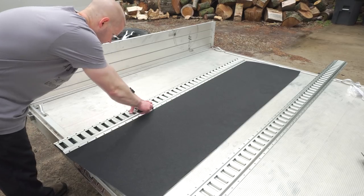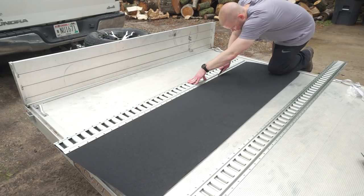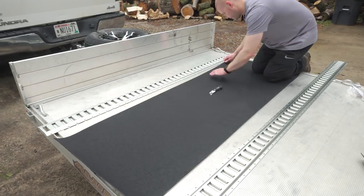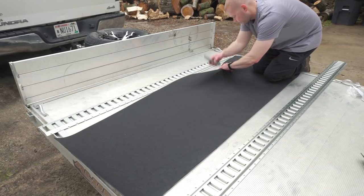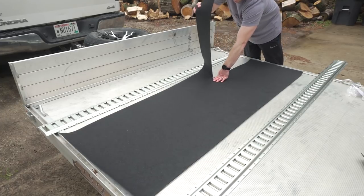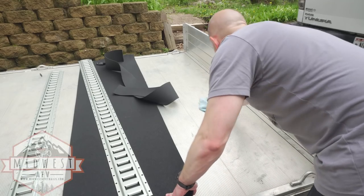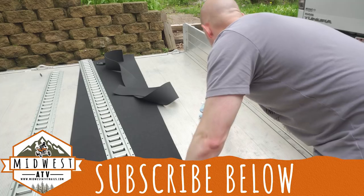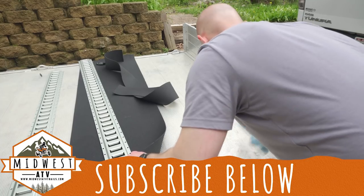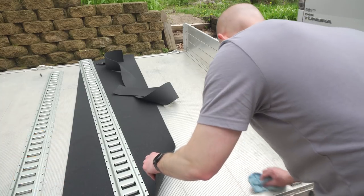The reason I'm cutting this rubber is because different types of metals often do not go well with each other, so I'm putting a rubber barrier between the aluminum and the galvanized e-tracks. One lesson I learned: if you score it deep enough you can really just peel it back. I already cleaned the surface off but I'm getting a little more gunk off so I have a nice clean surface to lay the rubber down before I put the e-track on top.